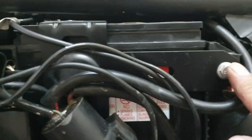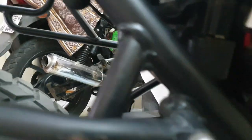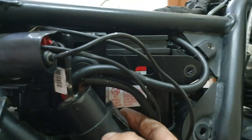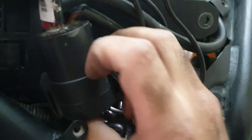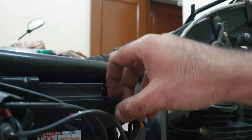Next, open this one here to remove the battery as well. Once you remove the wiring, you'll see there's a 10mm nut here as well, so let's open these two. Both nuts are out and the bracket is ready to be removed. But first, let's unmount this flasher and condenser from there.